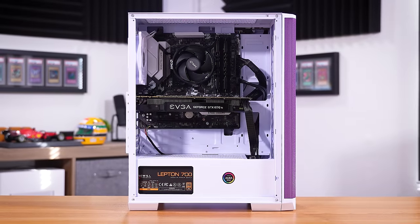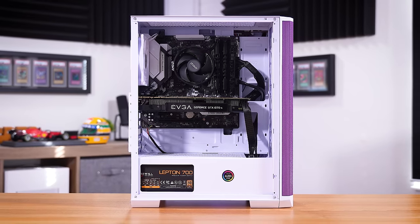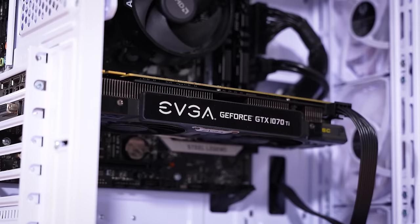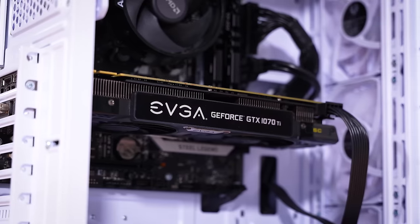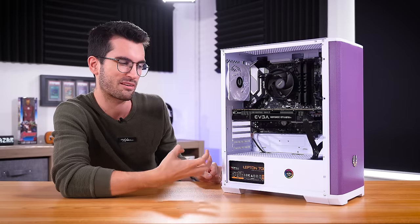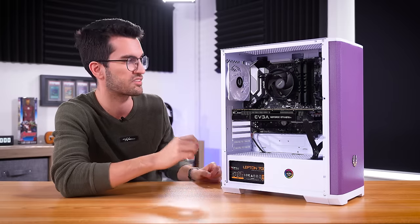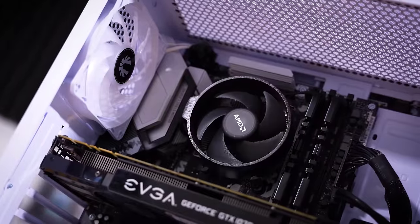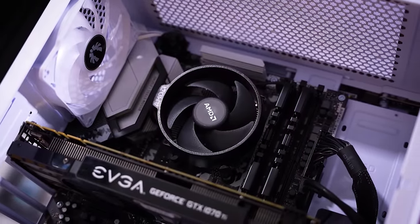A few ideas are crossing my mind. If we're not getting a picture out but it is turning on, and it was working only two weeks prior, maybe the graphics card has kicked the can — that's definitely something I'm going to hone in on, because it's an older unit. I don't think we're looking at a BIOS compatibility issue, but it is something we should at least check off the list. We could also try something as simple as clearing the CMOS, although the owner might have already done that. We need a starting point and to replicate the issue described.